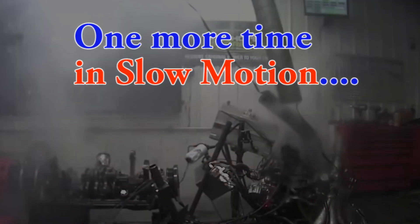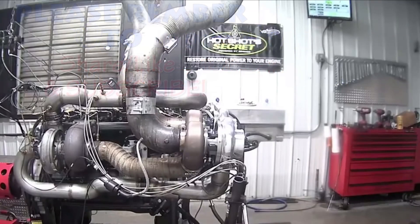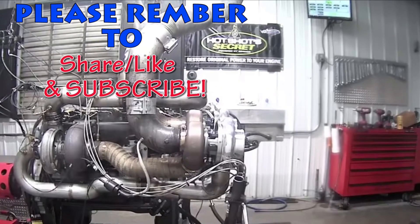Failing to test the fuel for your high performance forced induction engine can lead to overly rich or lean fuel ratios, too much ignition timing for what the engine can handle with that fuel, and ultimately could lead to the death of your engine. Hey guys, thanks for watching the video. Please remember to share, like, and subscribe. Now get out to that garage.